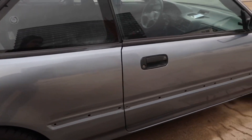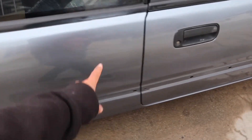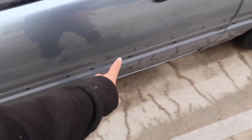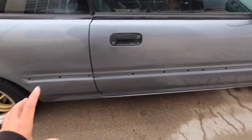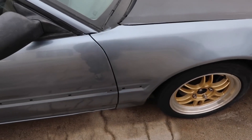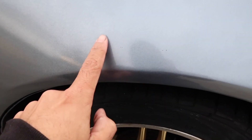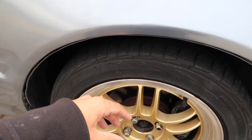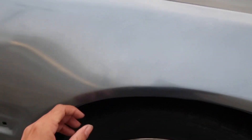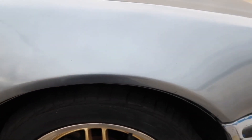Walking down right here, this was the hardest area because I had so many repair areas — right here, right here, here, here, here, and right there. This is where things kind of went a little south and it was kind of a fail. I was worrying about covering these up until I got to the fender and I ran out of base. Now you can see primer — there's not enough paint on here. You can see right there how it's a little bit light — that's primer. It's like 70% paint and 30% primer. So that came out kind of a fail. I don't know what to do with this fender — just repaint it or what. This is a junkyard fender I did end up pulling.